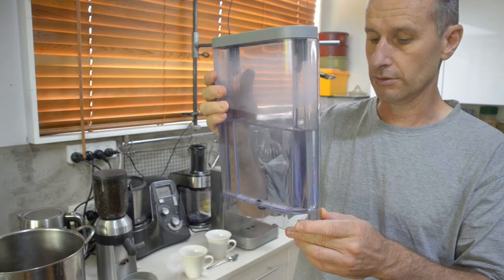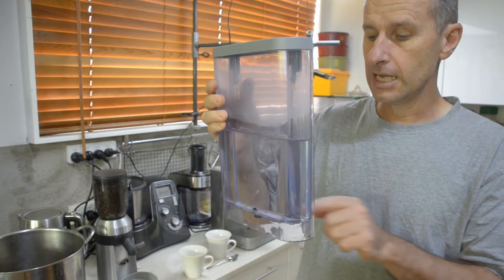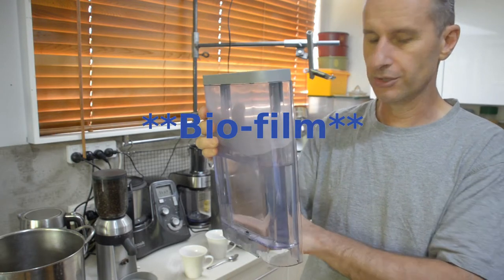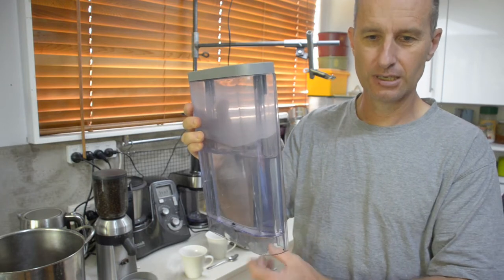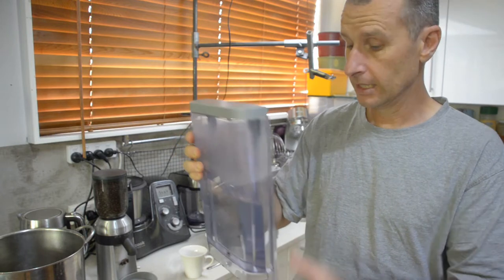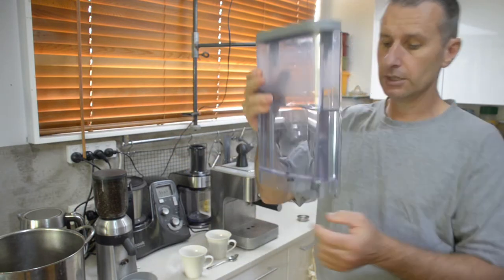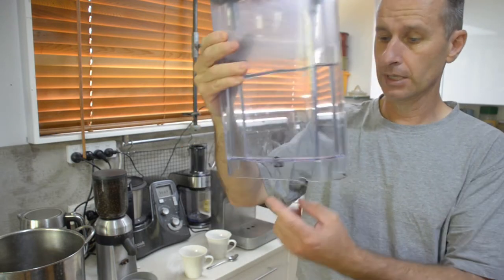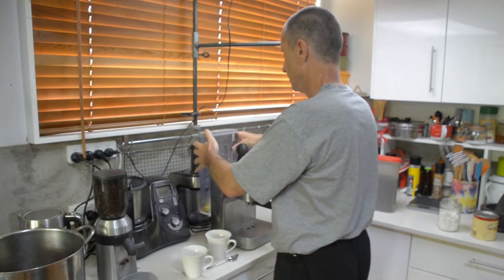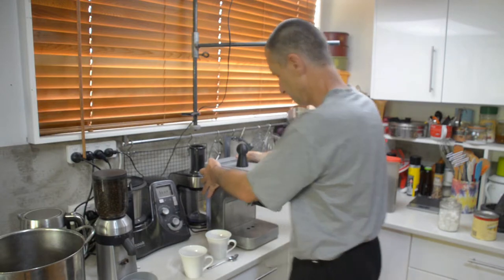It's important to clear these surfaces so you don't have any coffee sitting there, because the seal underneath is vulnerable to being cut by coffee particles. I should turn this thing on first. This machine has been cleaned out only a couple of times in its life and it's about eight years old — might be six, might be ten, that sort of realm. I only ever use filtered water — very important. I'll install the water container.